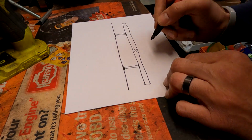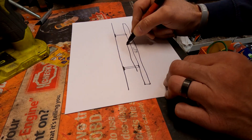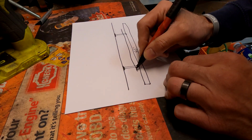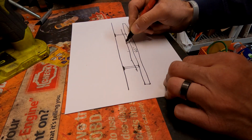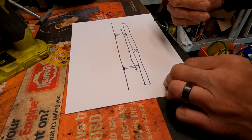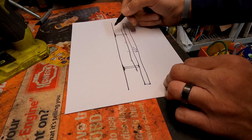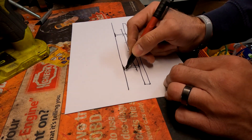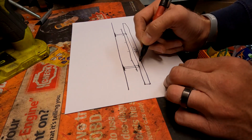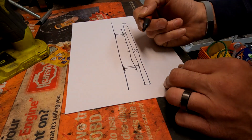And then what gives it strength is there's a strip that runs across the two connectors and through various spots, bolts into the pinch weld, where the inner and the outer rocker panel meet. So you're going to have a mounting point here, a mounting point here with self-tapping bolts, and I'm going to run a weld down each side. Nothing crazy, just to give it a little more strength. I don't know how good self-tapping bolts are. I'm sure they're fine, but you know, whatever.